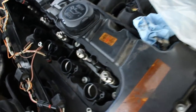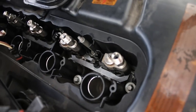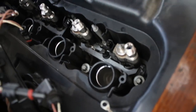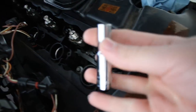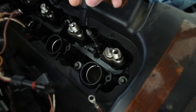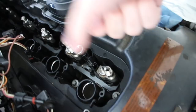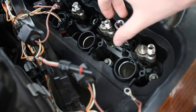Basically how this works — as you can see I already have it loosened — you have to put a long enough deep socket to fit through and go all the way down that bolt to untighten it. My normal deep sockets will not do the trick; you need an extra extended deep socket. I went on Amazon and saw one for $22, but people said the inside of the socket isn't wide enough to go around this stud. So then I saw another guy go down to Home Depot and get a medium-sized deep socket with a very open center. Went ahead and tried it myself — fit perfectly.